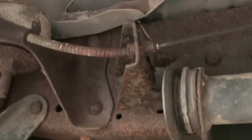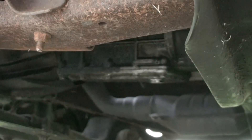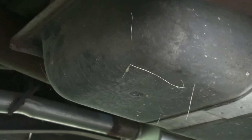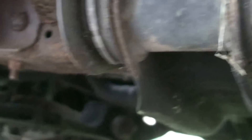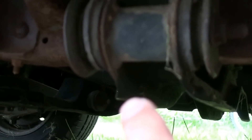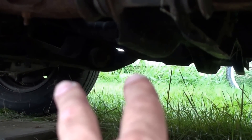I've got my helper Ryan in the truck right now. We're going to get under the truck and listen for the fuel pump. Ryan, just turn the ignition on. Okay, turn it off. I'm listening - I don't hear anything. Go ahead, on. Okay, we definitely don't hear the fuel pump. So next step: this truck has two fuel pumps - a high pressure pump up front and the main fuel pump in the tank. I'll disconnect the connector at the high pressure pump - it's a two-pin - and we'll test for grounds and power right there.